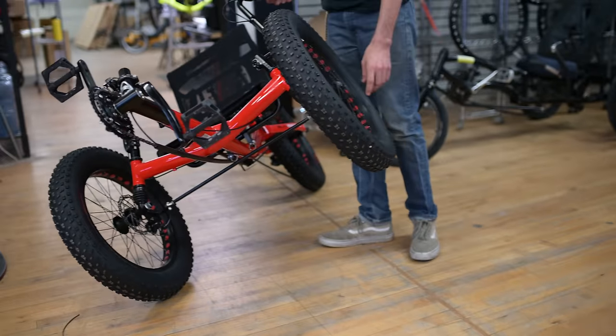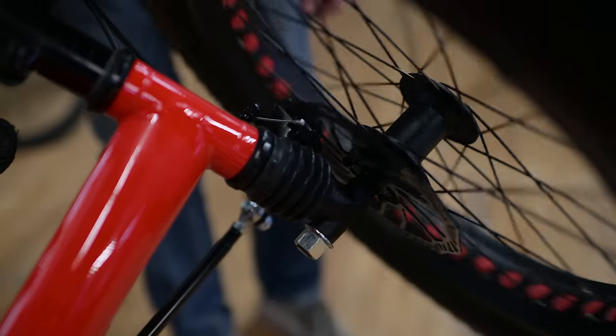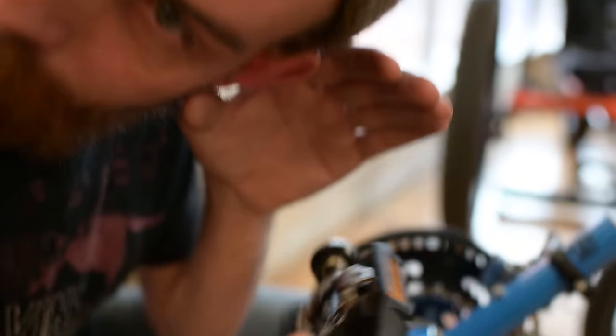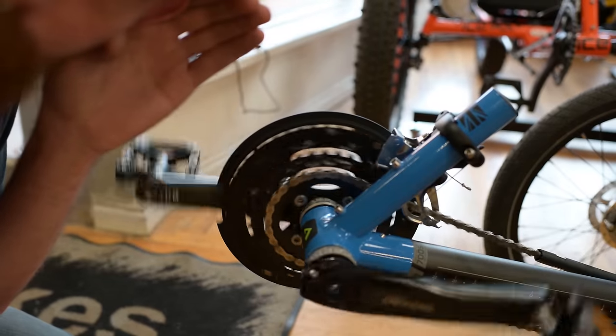Not only will your trike handle better, but again, you'll have less tire scrub. Check your brakes to make sure they're not rubbing. Tip your trike on one side and then spin the wheel. The wheel should spin freely and you shouldn't hear any rubbing. If you do, adjust the calipers as needed. Along with the front wheels, you should check everything on your trike that spins. Start up front with the pedals, making sure they spin freely with no resistance, then move to the front crank. Not only should you test how it feels, but use your ears to listen for any noises that could be signs of potential drag.